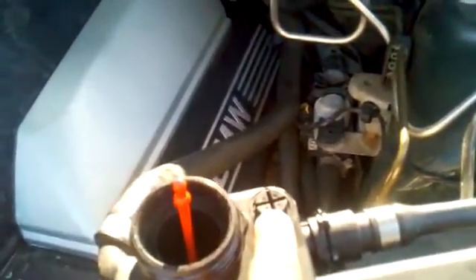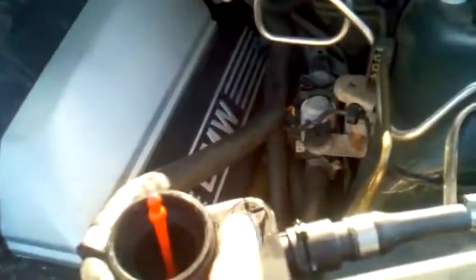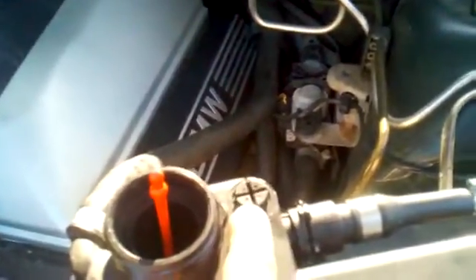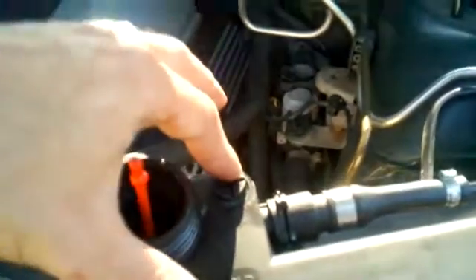Take this bleed screw off — it's just a plastic screw. I like to replace it if you're doing any work, because sometimes these crack and the end stays in and you have to drill it and use an easy out to get it out. Take that out, fill this with coolant until it overflows, put the screw back in, bottom it out, give it just a slight turn because if you over-tighten it, it will snap. Put the cap back on, run the vehicle with the heat — I like to put defrost on high — let it come to temperature, take it for a short drive. If it ever starts to overheat, shut it off right away and let it cool down. After it cools down and you've bled the system, open this cap back up when it's cool and do a final top-off until the float comes up.